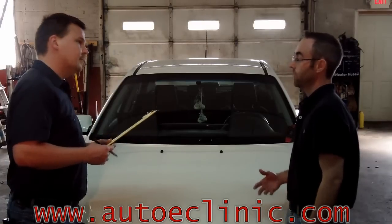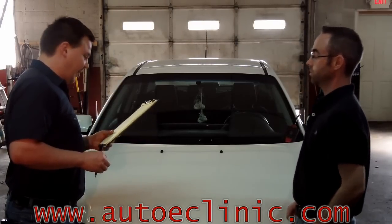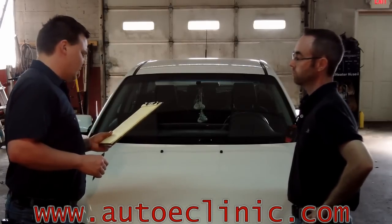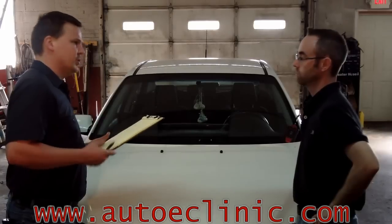Well, you know as well as I do, if there's a light on, there's a problem. May not be big enough for the customer to notice, but there is a problem. I think you're right. Anytime the light's on, there is a problem. Well, I'm sure you already scanned it. What code did you come up with? We've got a P0455 Evap gross leak code and a P0171, which is a lean code.